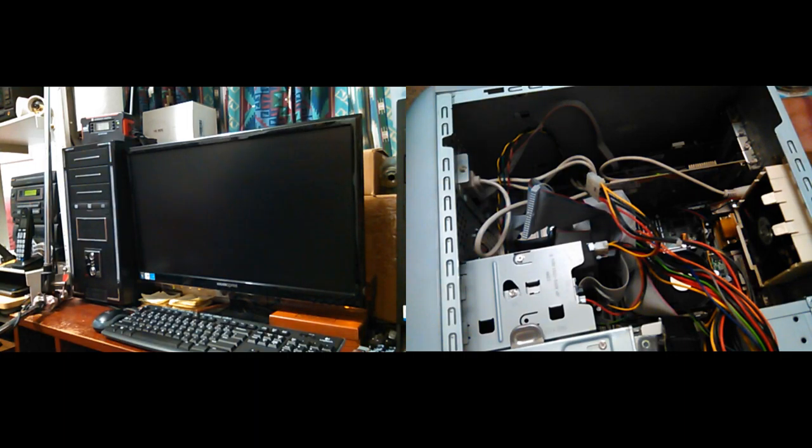Dang it, I turned my chair over. Hang on. I was going to say, it looks like maybe the video card is bad. It might have got blown out from that short of those pins. I might have one that I can... I don't know if I have one that's not in a machine. I've got some AGPs. Actually, one of those Pentium 3s in the garage that aren't really good for much. One of them said 64 megabyte in the BIOS, 64 megabyte memory, but it might have been onboard. If it's an AGP, I could put it in here. I've got a couple right here in my tool case, so let's see.